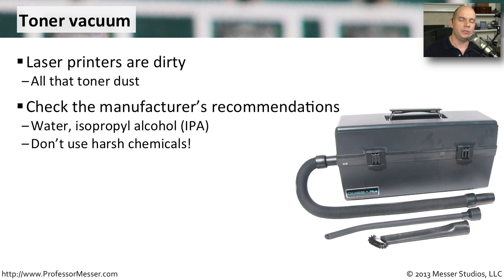But you don't want to use any harsh chemicals either on the inside or the outside of your laser printer. On the outside, generally a damp cloth is all you need. You don't want to use any hot water or anything that might melt any toner that might have been on the outside of your printer. So make sure it's a nice, cool, damp cloth without any drops of water that might get anywhere.